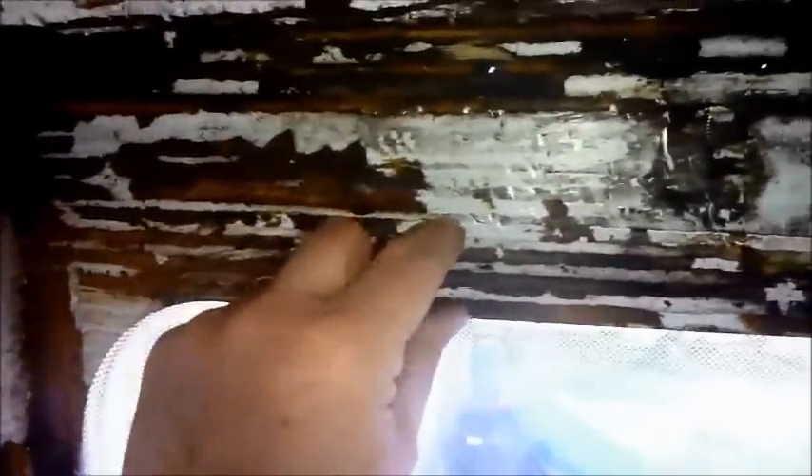This is about an hour later. I've taken it down to the aluminium — it's not a bad job, really. We've got some screws holding the window on, so tomorrow I'll take the window off. It's rotten back to about here, so I'll take all that back and then put a new piece in and bond it. You've got to bond new wood to the aluminium. There's two pieces: one here for the window frame, and then a big piece up here about three inches. It is tricky but it's doable, honestly — all I've used is a cheap knife.